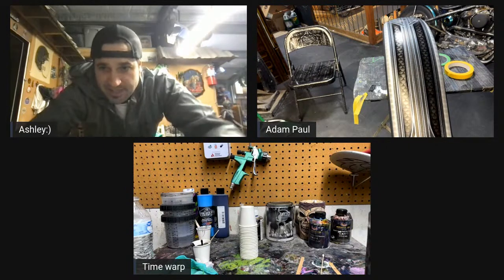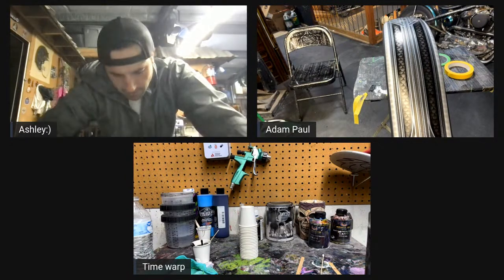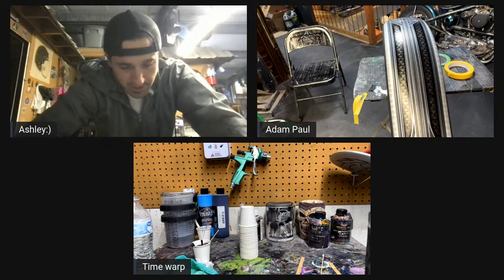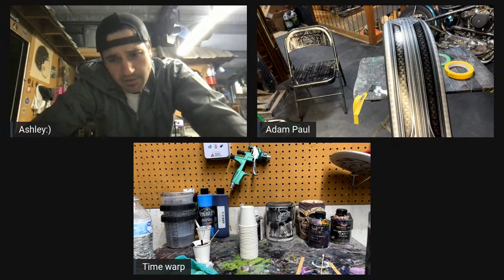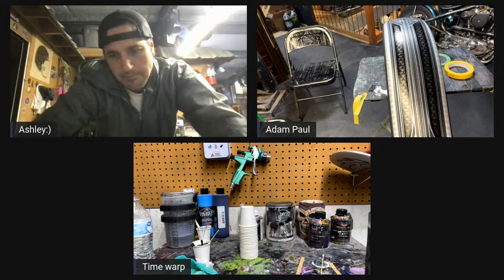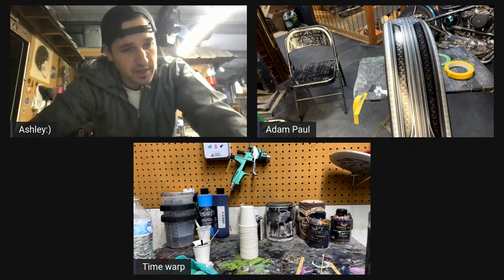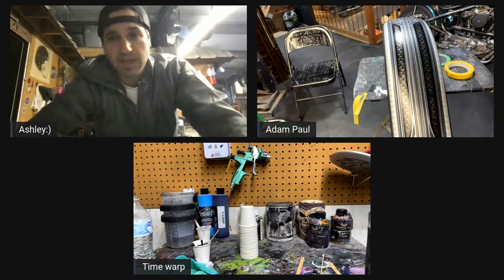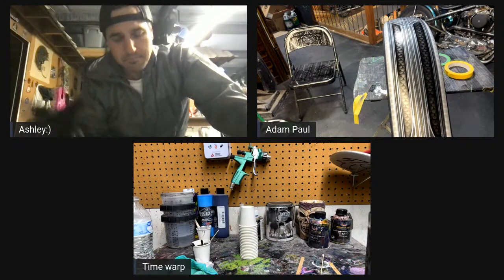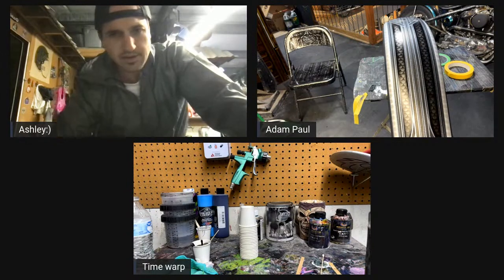Do you always lay out your patterns and effects with black? Ever do it with, say, just candy paint to create the depth you are looking for? Yes, I do that. If I'm going to edge the tape out with a candy, I try to use a darker candy. That way you have some contrast between the flake or the glass that's underneath. If you were to flake it, tape it, edge it with, say, candy gold, you're not going to have very much contrast. Maybe it'll look good, I don't know. I feel like you need contrast between the lines. So if I was to do it with candy paint, I would probably choose a purple or a dark blue or a dark red. And yeah, you can do that. I like the contrast between black and metal flake and candy, because you really don't know what black color is until you have black next to it, if that makes sense. So pairing up black next to a metal flake with a candy over it just looks amazing, in my opinion.